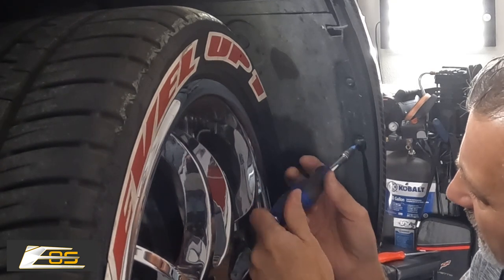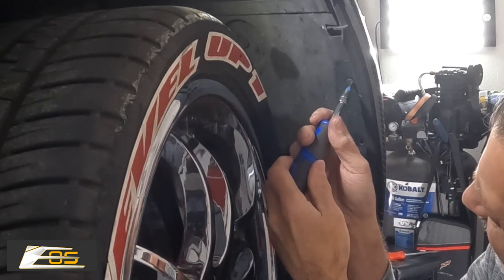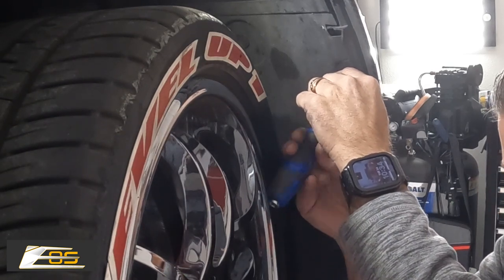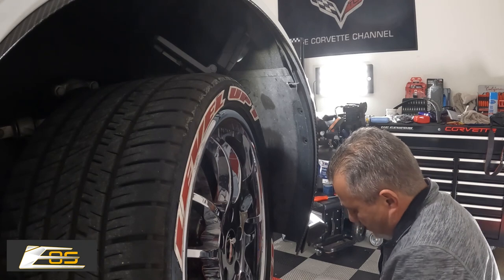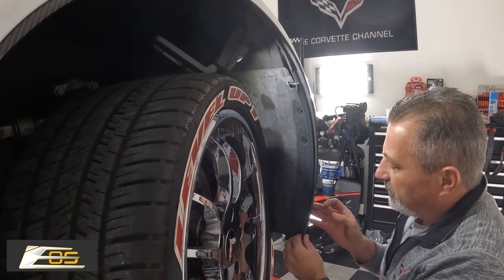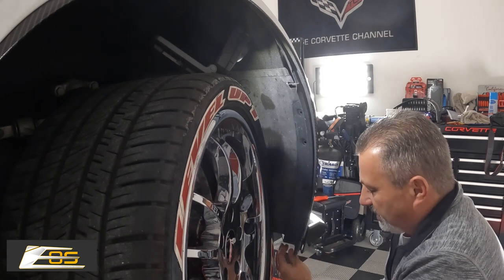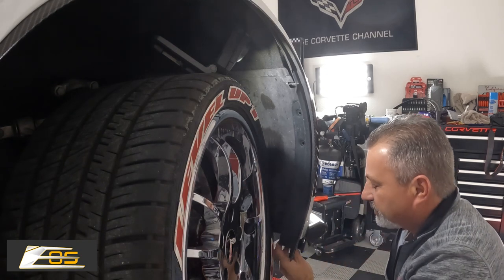I turned the wheel, and I'm only doing this on the lift to try to get a better camera angle — but you could do this on the ground. So we're going to pull those screws out. Now I'm going to pull that other screw out at the bottom. You'll see in a second when I remove this that the bottom 7mm screw is used to hold this piece in. You can see how easy that comes off. I'm going to go ahead and put that screw right back in because it is not needed on the new piece — it doesn't have that little latch or clip hole.